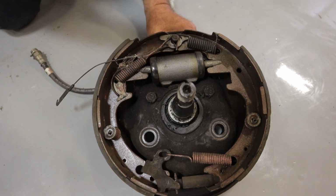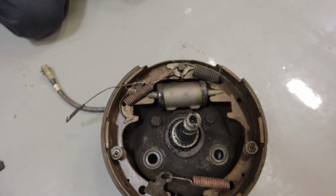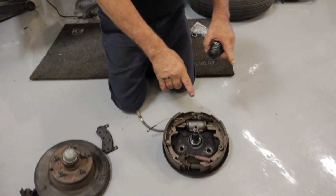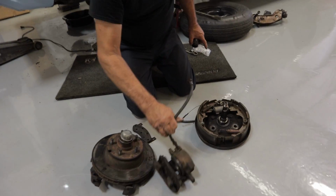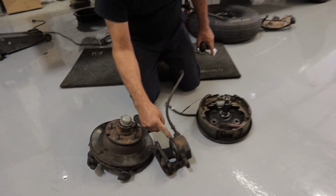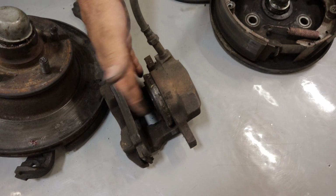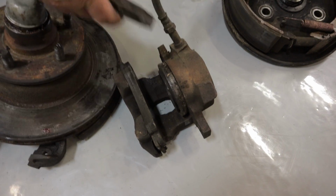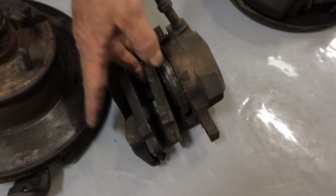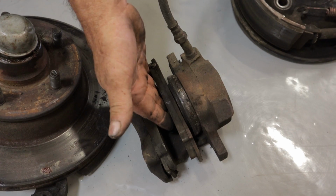The wheel cylinder. The wheel cylinder is the number one issue with drum brakes, and I'm going to show you why. A drum brake setup, unlike a standard production line disc brake setup, not an aftermarket one, you've got one puck. And when you step on a brake, you're pressurizing this chamber, the puck moves out and squeezes the pads together, right? By dragging this side back closer to the puck. So you've got one source of action on this brake setup.